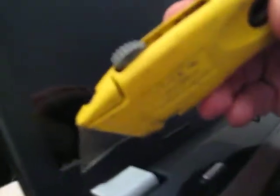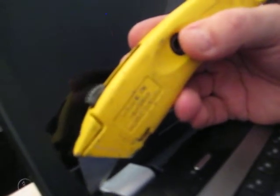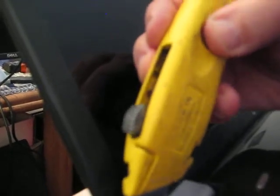We're going to use the knife to just very gently dig out a little cover that they put over the screws. It's already off — it's just a little bit of adhesive. There it is right there on my fingertip. You need to have a safe place for the small parts you're going to be taking off. Be very careful — you don't want to scratch anything. Just dig in gently, and there it is on the knife.